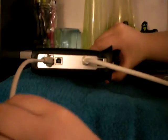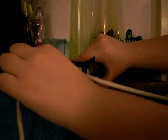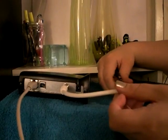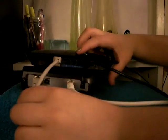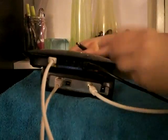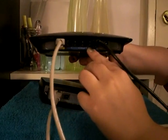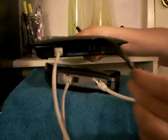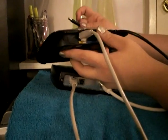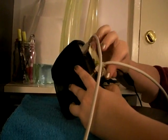Hooking up your wireless router, part three. So here we are again. One ethernet cable is hooked up to the back of your cable modem or your DSL modem right here. The coaxial cable is hooked up as well, nice and tight, and the other side goes into the wall where the cable comes out. The other ethernet cord goes from this ethernet port into the internet port on the back of your wireless router. The other ethernet cable is in one of the numbered ports for peripheral devices, and the other side is in the back of your PC desktop computer. So now what we're going to do is hook up the power so we can turn these on. You just find the right power cable and put it into the back where it's supposed to go.